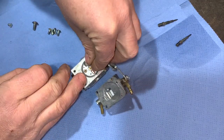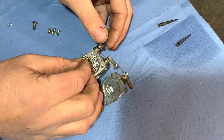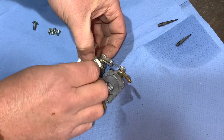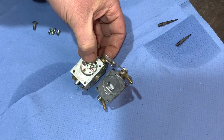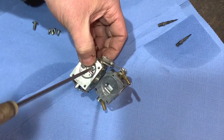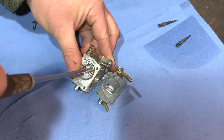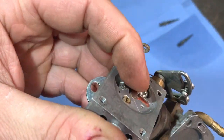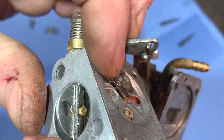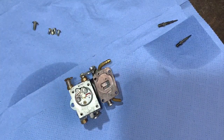So I'm going with the old needle valve and old spring. I'll just get that balanced in there — there we have it all together. I'll get it in and put the screw in. I've put the little bolt in there with a screwdriver to tighten it up. I felt it click — that's all good. You can see the spring is in place just under there. Happy with that — it's ready for the new diaphragm and gasket.